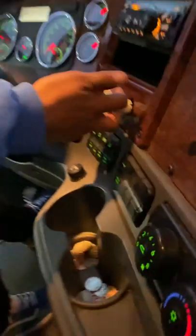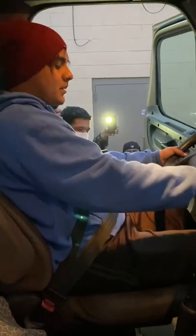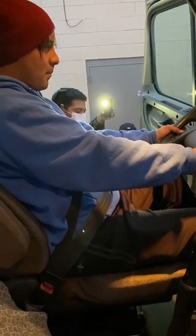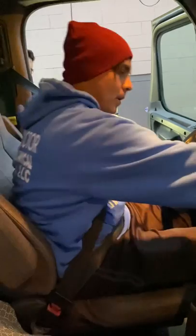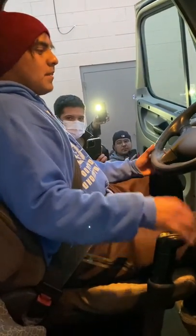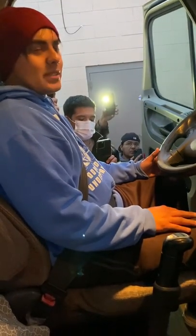So pop out the tractor first and then push in the other one. I'm gonna check my tractor brakes. Slowly release the clutch. When you feel the tug, you push it back in. Okay, so my tractor brakes are working properly. Pop out, put in neutral. Okay, ma'am, my tug test is a good test. I'm gonna proceed to check now my service brake test.